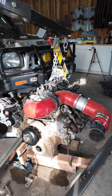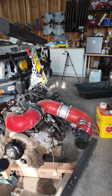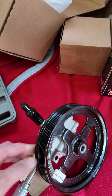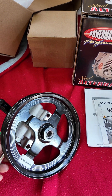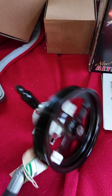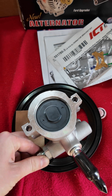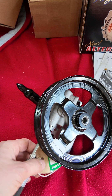I feel like I've figured out pretty much everything I need for the swap except the power steering and air conditioning bracket, and the engine mounts partially. For power steering, I like to use a GM Type 2 power steering pump found in the early 2000s Corvettes. I noticed it's got an M16 by 1.5 output, and that's the same thread that Land Rover uses — it threads right in and it seems like it's going to fit perfectly. No weird fittings or adapters needed.